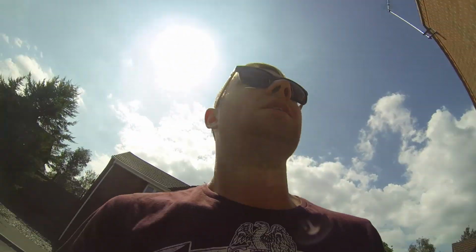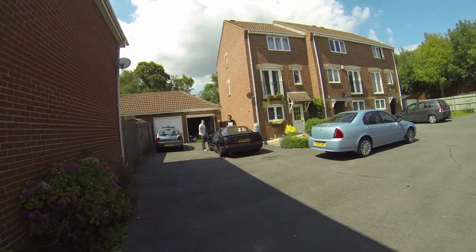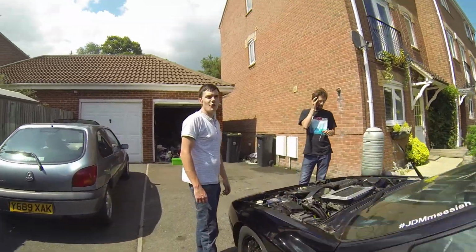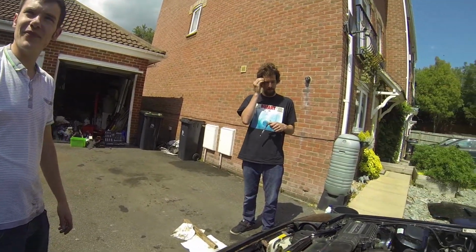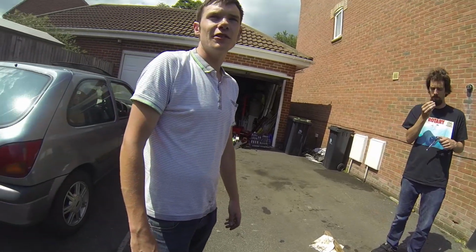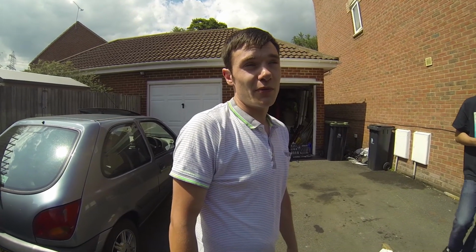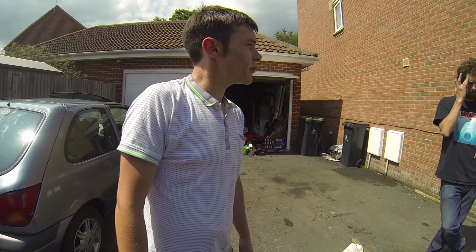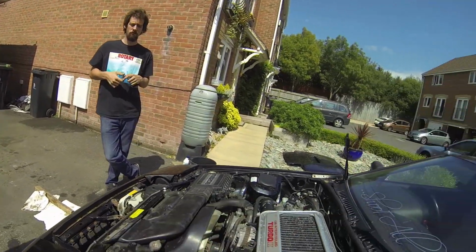Back at Johnny's. I hear they've progressed. They've replaced the TPS and got a fuel cut. Hello. I know, I've missed all the happenings. So much better. Yeah? So different. Is it a different car? So, what, new TPS? New TPS, we've got it as close as we can to the range, which is between 0.8 and 1.2. We've got it about 1.11 or something. And wide open throttle is at 4.98. Oh right, sweet, so it's a good TPS. They said anything over 6 was bad, wasn't it? No, we've got a good TPS.